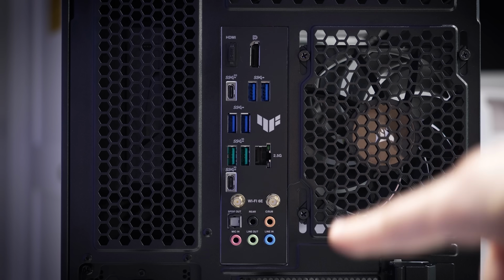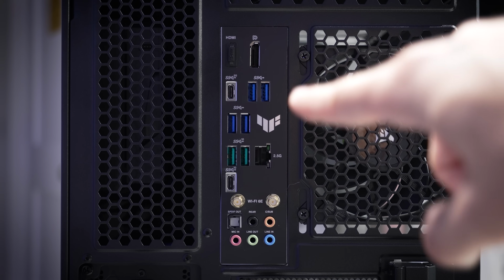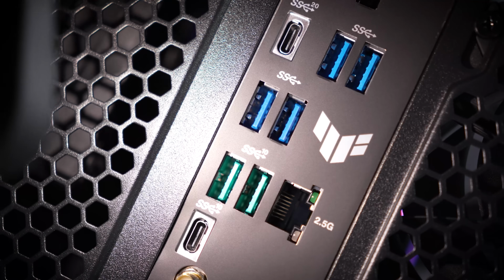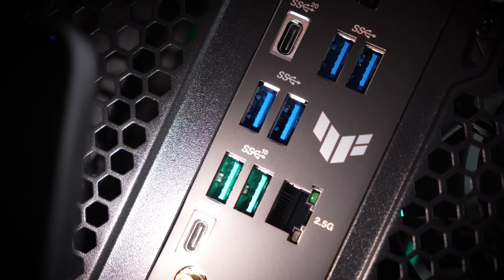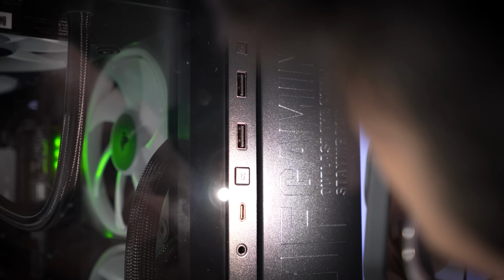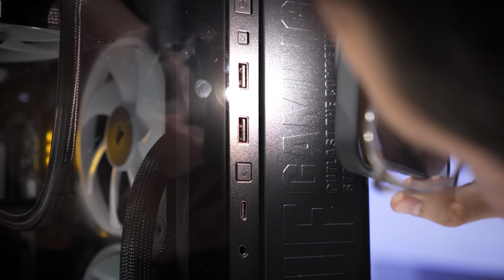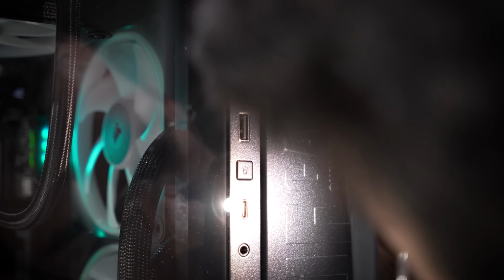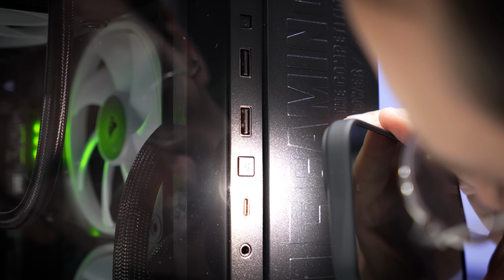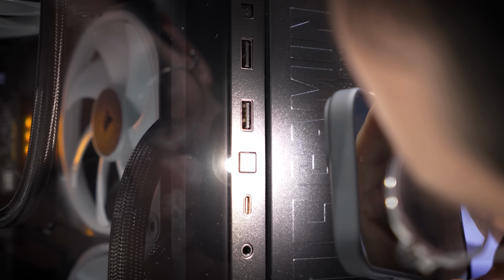But I first want to look at the back of this motherboard here, make sure that we don't have any shorts internally in any of these USB ports. I've seen that throw USB overcurrent codes time and time again. I will say though, all of these look good. Yeah, nothing sticking out back here. Likewise with the front panel, the two type A ports are clean, nothing crossed, nothing shorting. Same goes for type C. It's a little harder to see with type C because it's a much smaller, more fine connector, but it looks good at least on the port side.